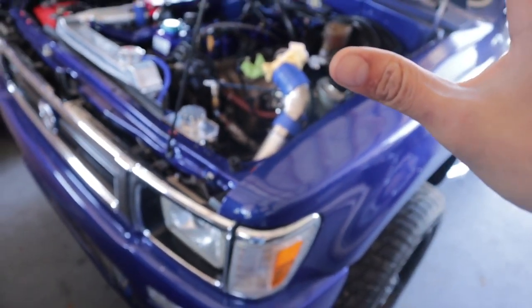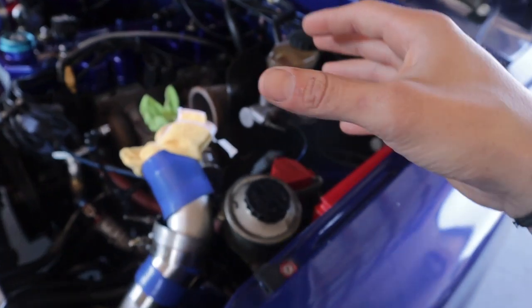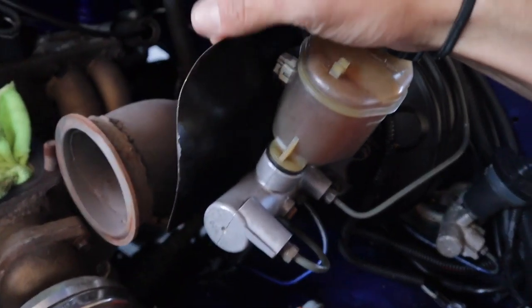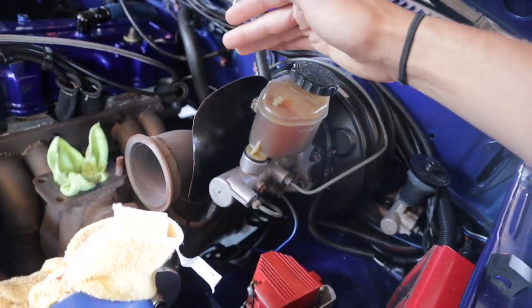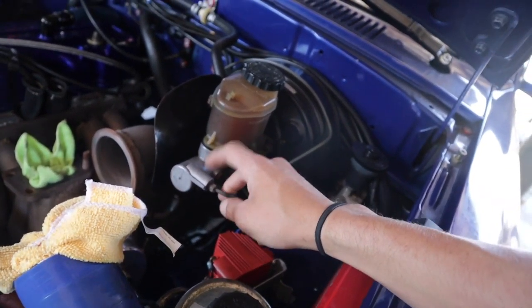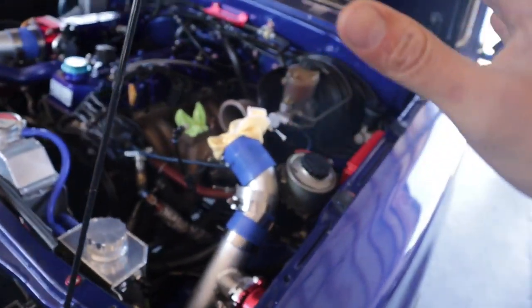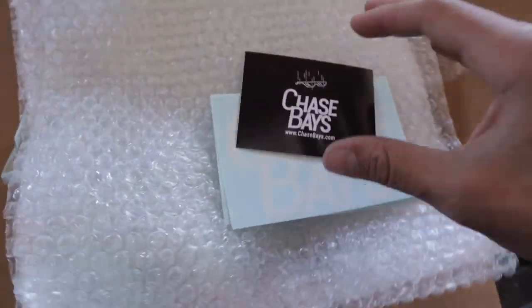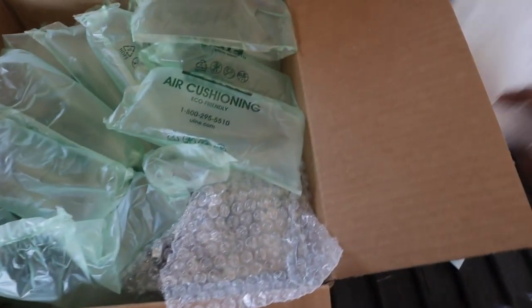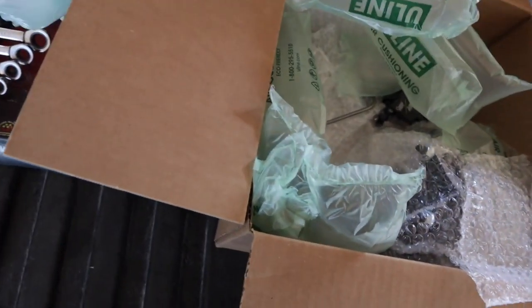One of the biggest problems that I have with Tina is the braking. My turbo housing and the downpipe is right next to the brake booster. I have this shield already, but it's not enough. It keeps heating it up tremendously and my brakes get very spongy. So I called up Chase Bays, gave them my brake pedal ratio and the bolt pattern of my brake booster, and they were able to pair me up with a brake booster kit that they actually sell.